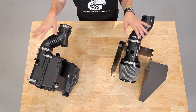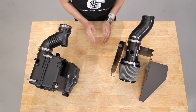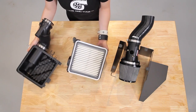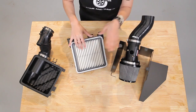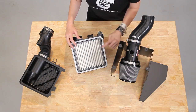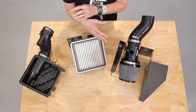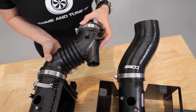The first obvious difference is the box. This will affect how air enters the system from the very beginning — it can affect the heat, volume, and the flow of the air. Next, you can see the two different filter types: panel and cone. The filter media itself is different too. Even the density of the cotton gauze can affect the readout our sensor provides, because a high-flow filter allows more air to flow than the stock one.